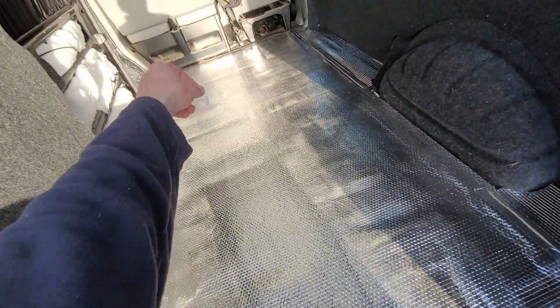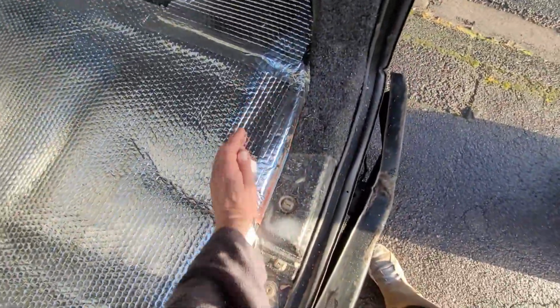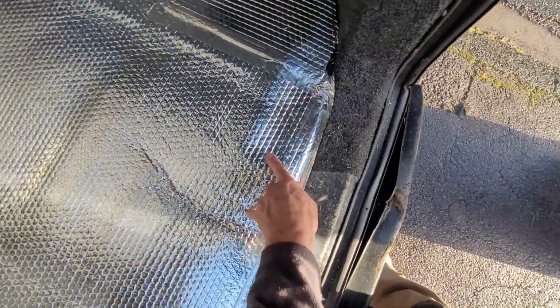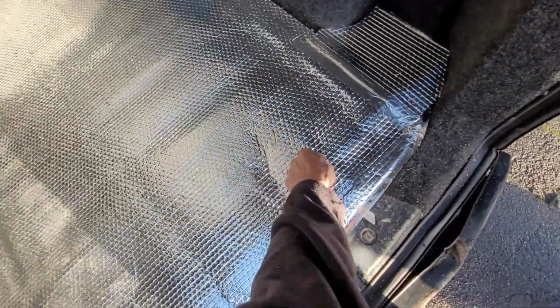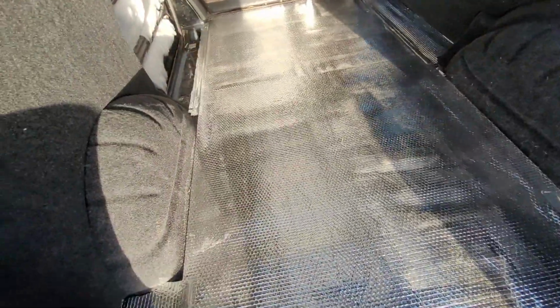The smallest, tiniest of stones will get picked up in the floor, so we need to make sure that the floor is super clean. So what I'll do is I'll just go around and reference particularly just that end. This end I'm not worried about. I know I've got the battens, but if I just mark like that, when I put the floor in, I know down there I can just put a screw. I'm going to do the same here, in the corners, up the ribs, etc.